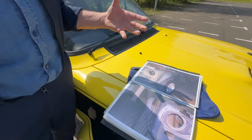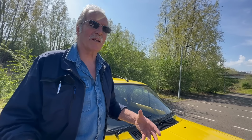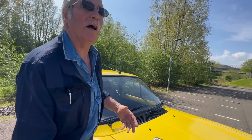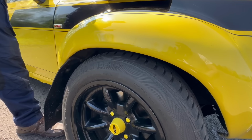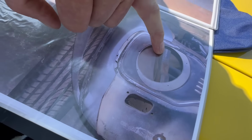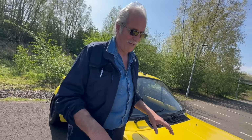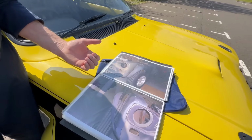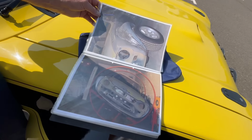But I had a weight problem. I didn't know the finished weight of the car, because obviously the car was going to get heavier as it was getting built, so it would upset that. So I had a guesstimation of the weight. You can see in the photograph there tractor weights, and there's a couple lying on top of the engine, and they're 35 kilos each. So I put a couple of hundred kilos in, pulled the arch so it was legal across the wheel, and then filled it in, as you can see in the next photograph. So all steel as well, no fiberglass obviously.